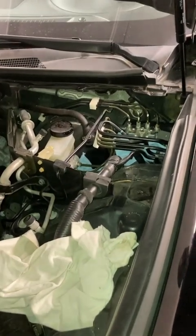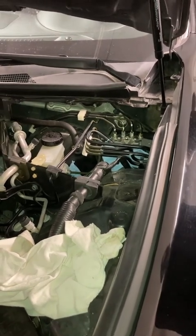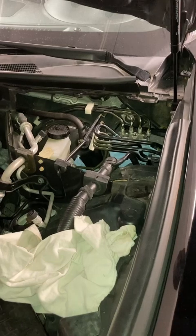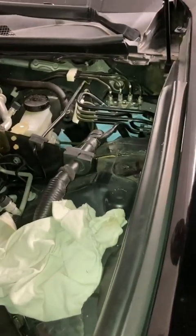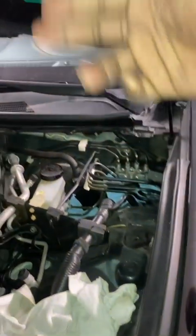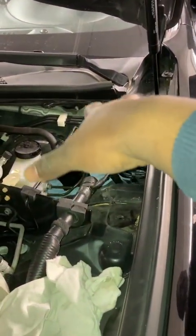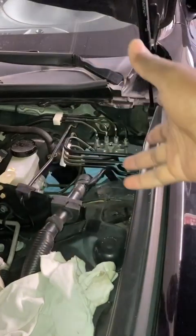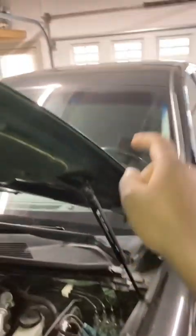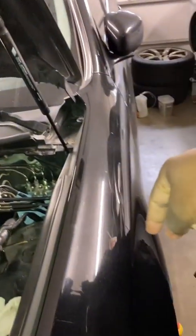Would you like me to teach you something? Have you bled brake fluid on a vehicle before? Yeah, the one time with you. Oh, it was your car? Yeah, it was my car. Okay, so bleeding brakes on a vehicle — traditional wisdom was that you're supposed to bleed from the furthest wheel and then come toward the master cylinder compartment.